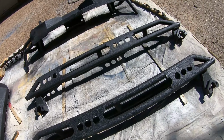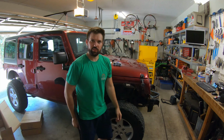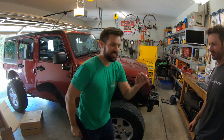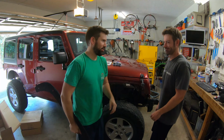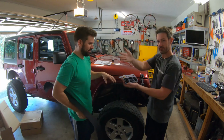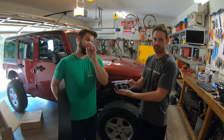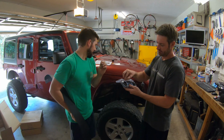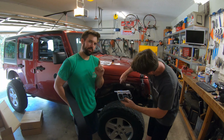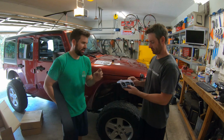So while this dries, the next trick is to try and install the fenders, which are an adventure of all their own. I might need a new tool. Rather than use weeny little plastic clips, which are scattered about the garage floor, the new metal fenders use bolts to bolt everything together. And the bolts need something to go into, and they go into these threaded rivets or rivnuts. I think I remember now, before ordering this, there were some comments about people buying the correct rivnut tool.